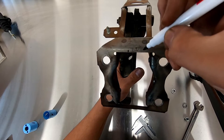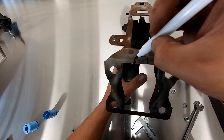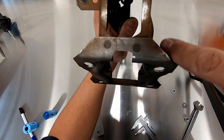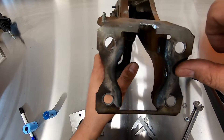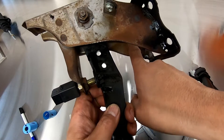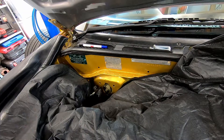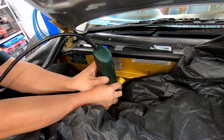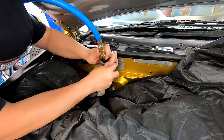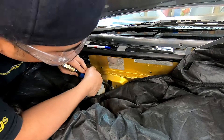Moving on to the pedal — in some cases you'll need to clearance the top of the pedal bracket depending on what master cylinder you're using. Wilwood master cylinders mount with bolts vertically, which interferes with the brake pedal bracket once the master has moved up. Stock master cylinders mount the bolts horizontally, so make sure you check your clearance before you test fit. I've also added a few extra welds to the brake pedal bracket for strength — these are a weak point in all Silvias and Skylines. Make sure you cover up your engine bits with non-flammable sheeting, and put a wet towel inside the cabin so you don't start any fires when clearancing the body.